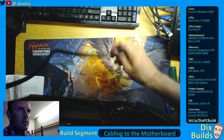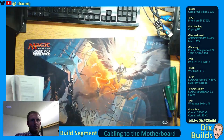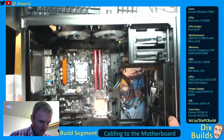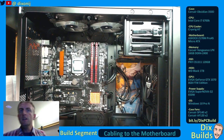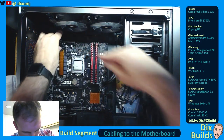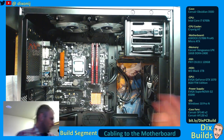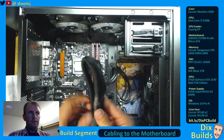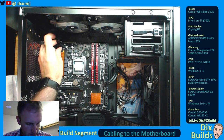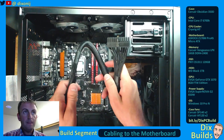This is going to come down to the bottom and eventually come through this bottom grommet. We're going to make this a lot neater on the back — you can see it's kind of a mess right now. So we've got CPU there, our CPU fan is going to go there, and our 24-pin motherboard connector is this last giant cable. That one is what powers our CPU — which is our actual processor. Remember, a CPU is different from the actual computer itself — that's just powering this specifically. This giant cable is going to power everything else on the board.